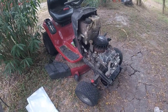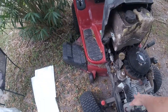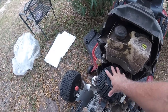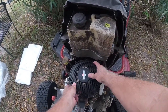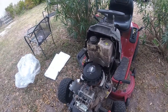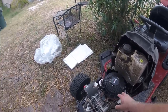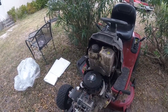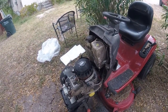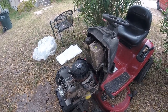Today I'm going to replace my camshaft that's inside the mower. The symptoms were that when I would turn the key the starter was not powerful enough to turn the crank — it would go halfway and stop. Things I tried: testing the starter, which works because it can turn the crankshaft. I got a brand new battery, I adjusted the timing, and I looked at some videos on YouTube and I think it's the camshaft.